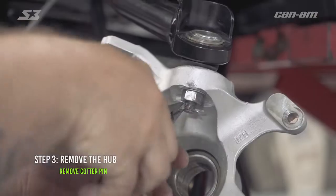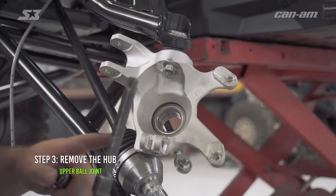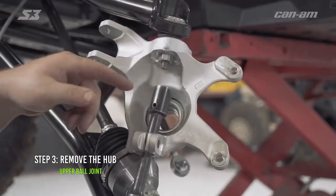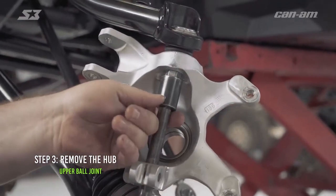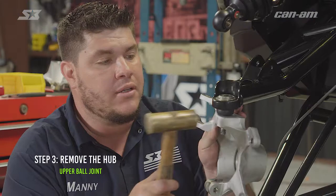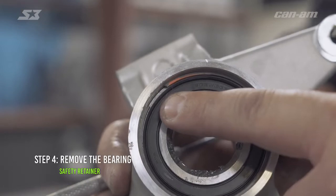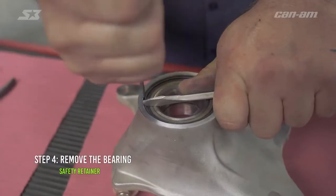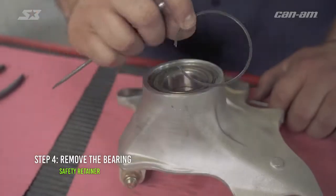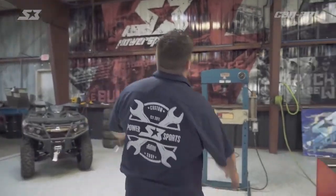Now we got our axle out of there, we'll go ahead and break this clip loose off the upper ball joint and then we can take the nut off. Using your six inch extension, come in through the lower ball joint hole, put your 19 millimeter socket on there and then go ahead and break the upper ball joint nut loose. Using a brass hammer, go ahead and tap the knuckle a little bit until she breaks loose from the ball joint. So before you can press your bearing out, you need to take the safety retainer clip out of the way — hold it on one side with your screwdriver, grab your pick or another screwdriver and pop the other end out and then work it around the bearing. Now that we got access to the bearing, we'll go over to our press, get the old one out, put the new one in.